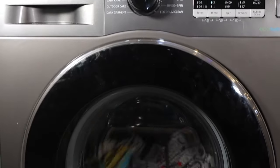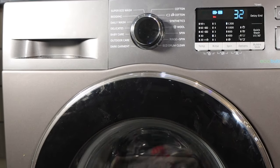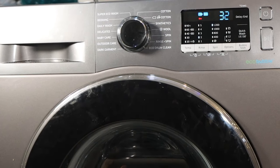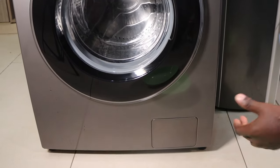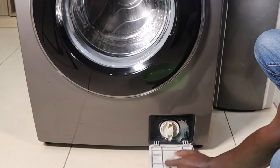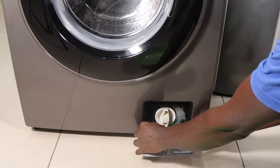After the completion of the wash cycle, you should now clean the drain filter. It's important you proceed to clean the drain filter. However, before you open the pump filter, I'd advise you drain water from your machine using the emergency hose pipe. If you don't do that, a ton of water can spew from the machine and flood the floor of your house.